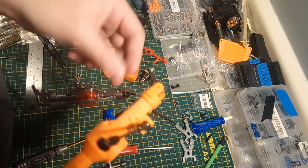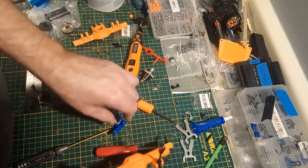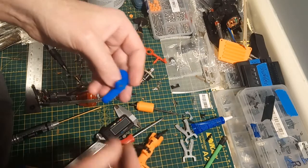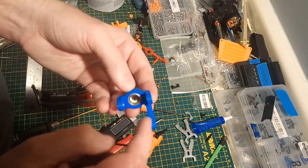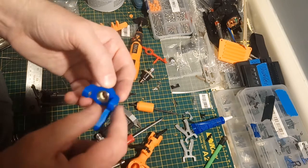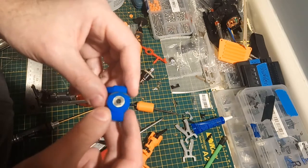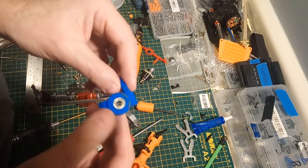If you have existing knuckles you can use them with this plastic axle. If you have a driveshaft with different dimensions — like say 5 and 12mm or something — all you've got to do is modify this one hole. You can start with the standard Axial-compatible one or the WL Toys one with the smaller hole. If you really can't figure it out, using something like 3D Builder in Windows is an option. It's really not difficult to poke an extra hole into a part — that amount of learning and DIYing should not be beyond anybody.